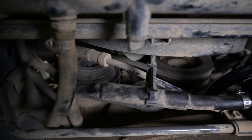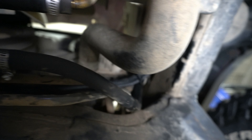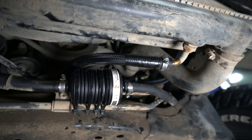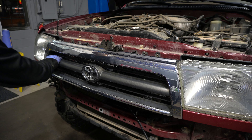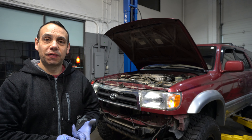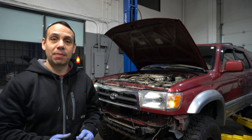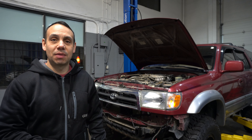Everything is tightened up. Peeking in you can see the filter, the lines, and up behind I've secured everything with a couple of zip ties. The nylon coating will help protect against rubbing. We'll go ahead and run it to make sure nothing leaks. Make sure you check all your connections, check for fluid leaks, and set your fluid level. If you have further questions drop them in the comments below — if you found this video informative, give it a thumbs up and consider subscribing. Thanks so much for watching, goodbye.